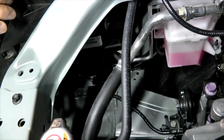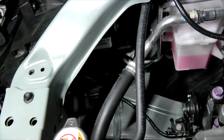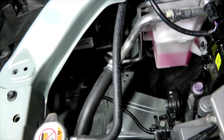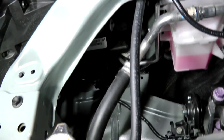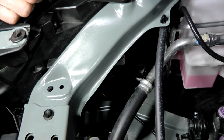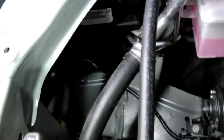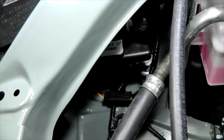The reason why this was done is because originally the lamp comes with four wires for vehicles with different configurations. In our case, we are only using the turn signal, the marker light cable, and the ground. And this connector makes it easy to do this configuration.